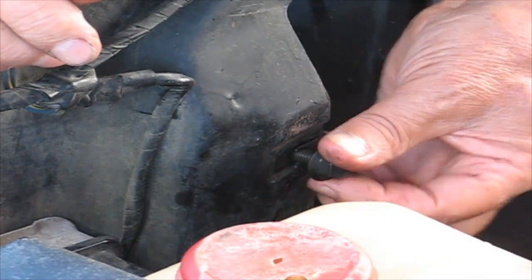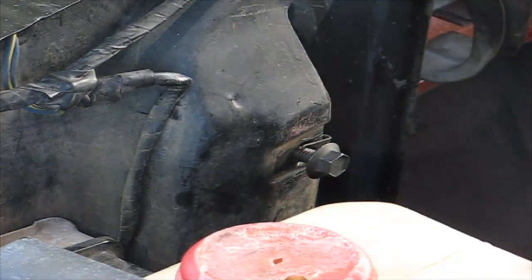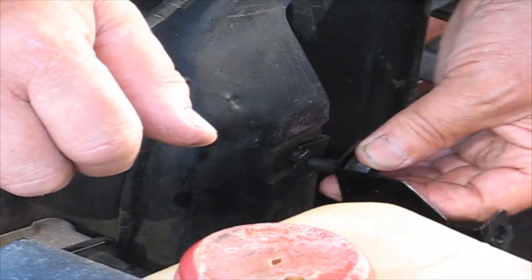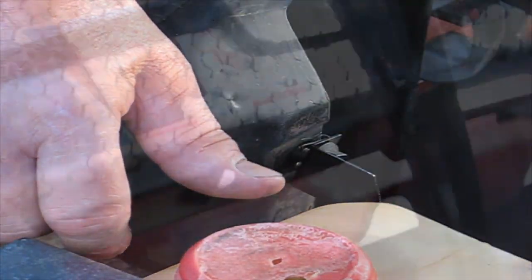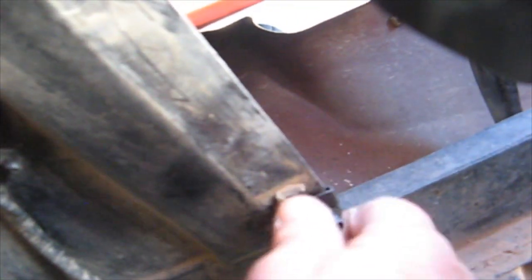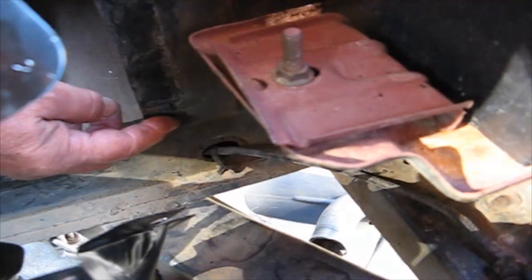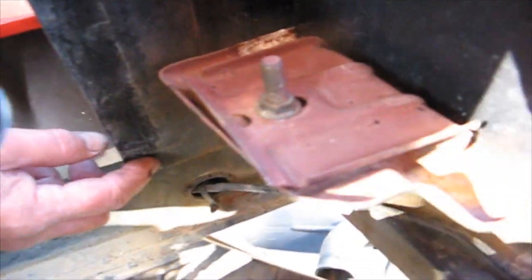So that way the radiator bolts on, and then these clips will go on like this, and then the radiator right in there. See, so I moved that clip down a little bit, and I'm going to check this bolt so it goes in there, because if it doesn't go in there now, it's certainly not going to go in there later on. Okay, here's the last hole. Here's the one up on top. We already did that. Okay, so now we'll do the last one here.